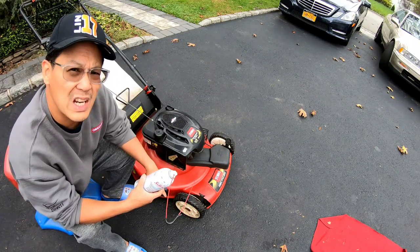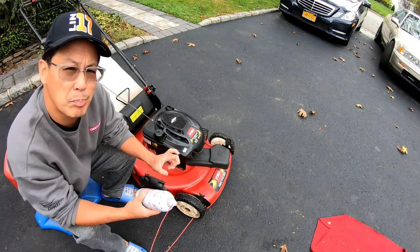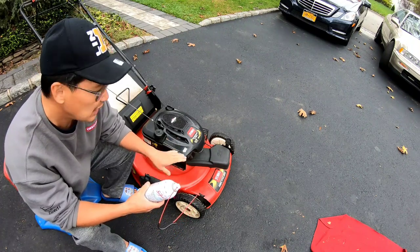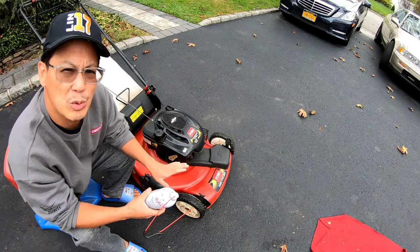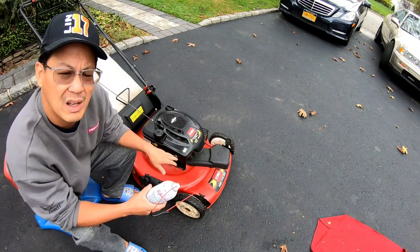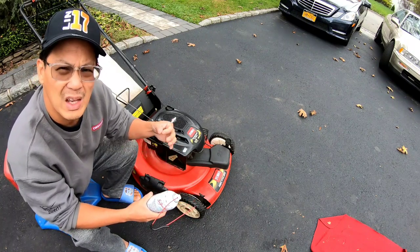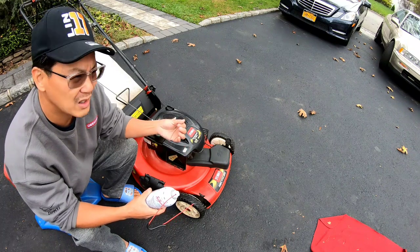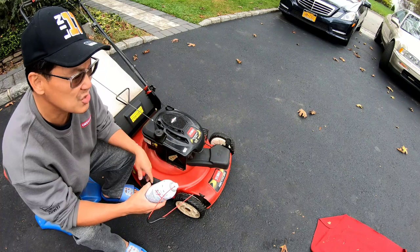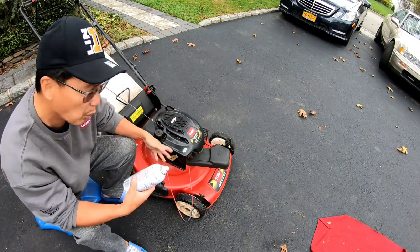And then basically while the engine's running, you would shoot some of the spray in bursts, just before it stalls, you'd stop, you know what I mean? And then once you've done that a few times, maybe 2 to 4 ounces worth, what it does is it cleans out the carbon and also the intake jets from any clogging, you know, ethanol, gunk, gel substances that might be clogging your jets. This is supposed to just vaporize all that stuff while it's running.